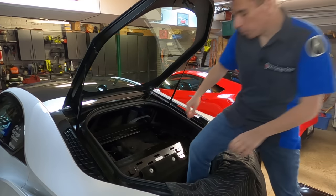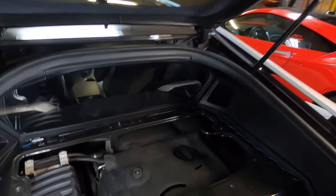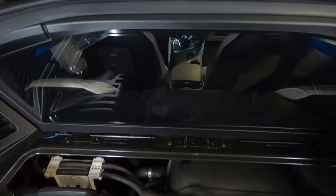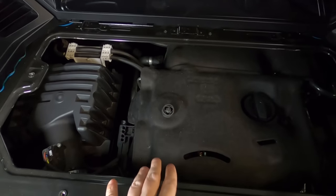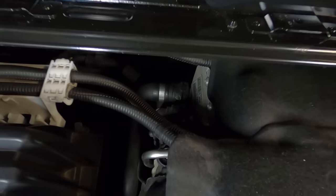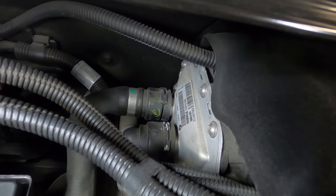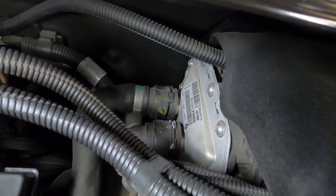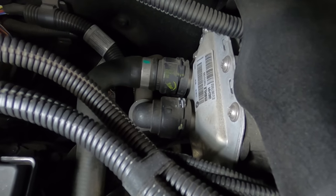In order to give you a better idea of what I'm talking about, let's get in here closer to the engine. This is the front side of the car up there, so this is our firewall, and this engine compartment is very, very small — about one foot by two feet approximately. If we look up here on the intake side of the engine, that silver piece right there — that component — that's the water-cooled intercooler that's integrated into the intake manifold of the car. Underneath there is where the coolant temperature sensor is located.